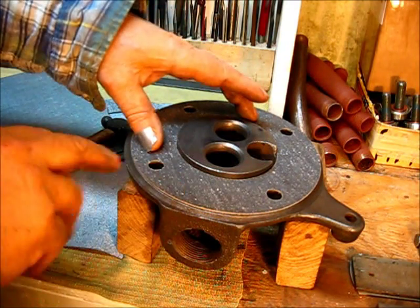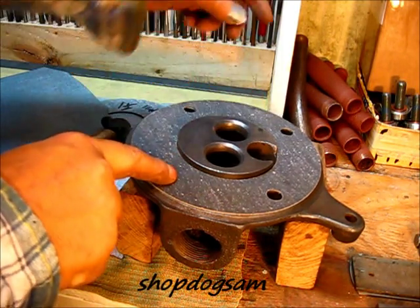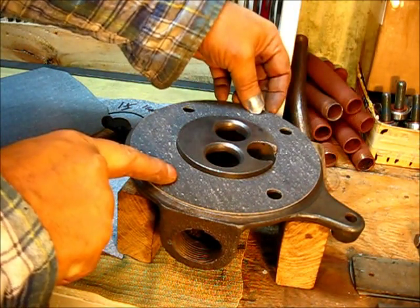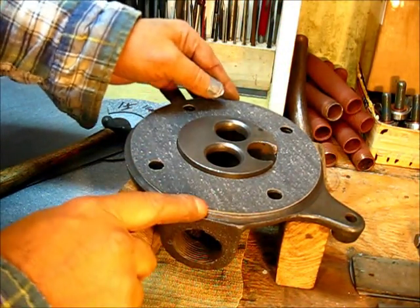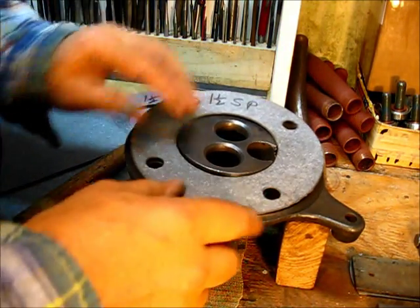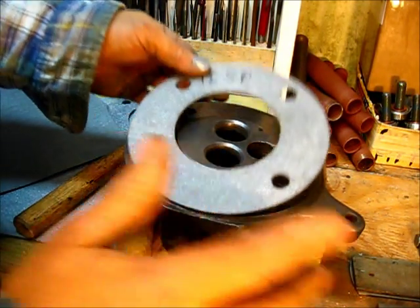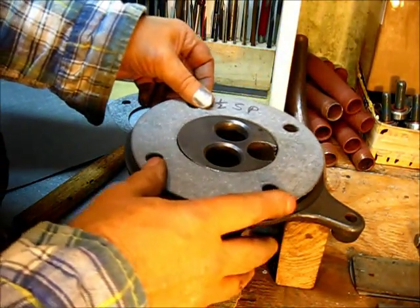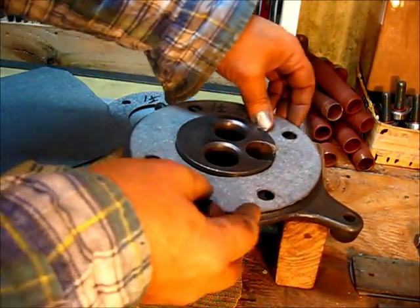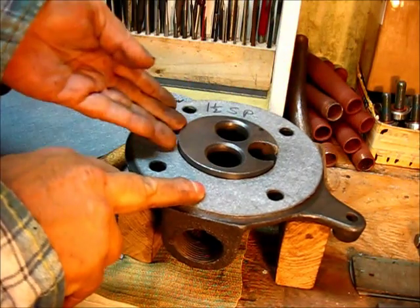The point is when you put this gasket on the engine and bolt it down, over here you're going to have some metal where the head is bigger than the gasket, and up here the gasket will be bigger than the head — so it very seldom fits perfectly. When I make a gasket, I leave it proud on the outside and don't even attempt to make it fit the outside. But you can see this is a really good fit on the inside — no gap, fits perfectly all the way around.